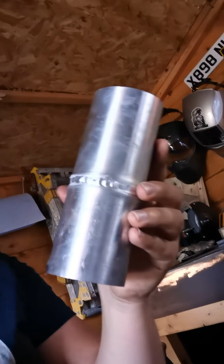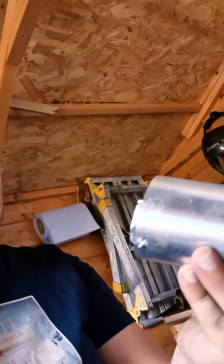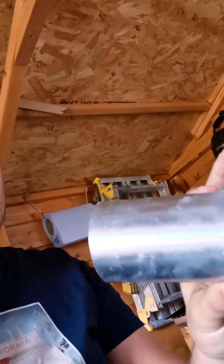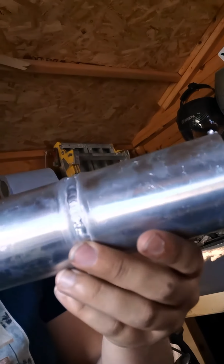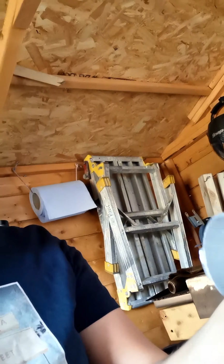So I'll be making the intercooler pipes from hard pipe kit, which, I mean, this is just literally a little bit of aluminium. It looks like 2mm thick. So yeah, just cut and welded, so it sits and it's solid. It will hold boost. We'll get that bit put on, and then once it's on, they won't be going anywhere. You probably only need 2 sort of silicone hoses by the end of it, just to make it fit to the standard pipes.